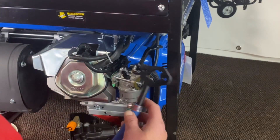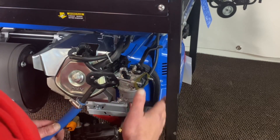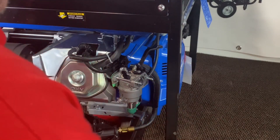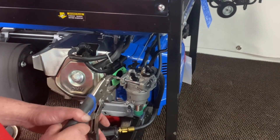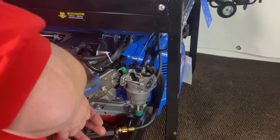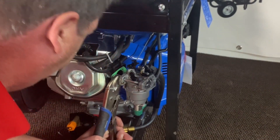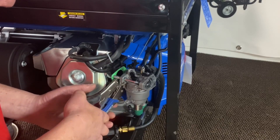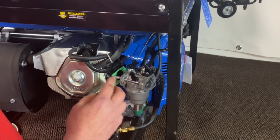Now what we're going to do is get ready to install our slim adapter. We're pulling the air cleaner out away, so it's going to be close to the frame. We're going to remove this — you will not reinstall this back on here. We'll supply you two new gaskets, so just set that to the side. Pull your gasoline carburetor away from the engine block. Make sure you don't hit that gasket back there. Get vice grips — we only need to turn these out about three turns. Make sure you lock down pretty good and pop it loose, then turn them out about two or three turns on each side. Pull them out three turns and you're in good shape.